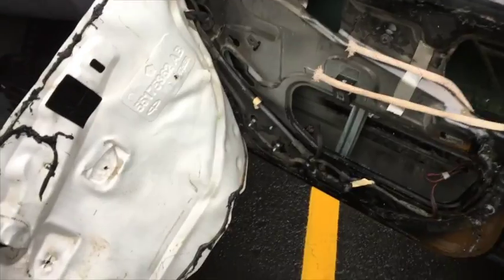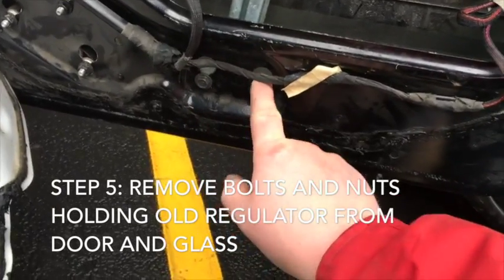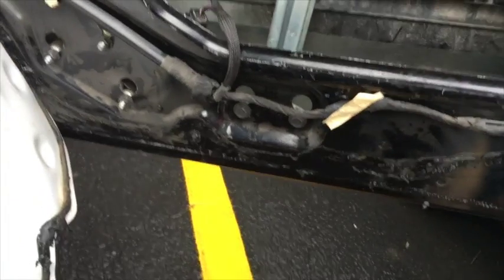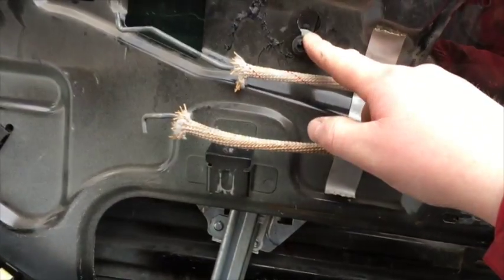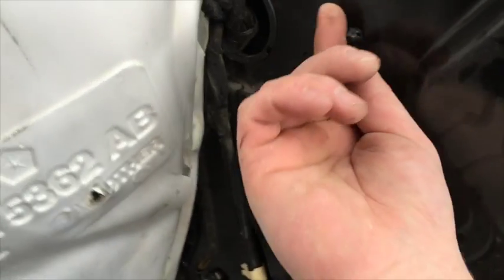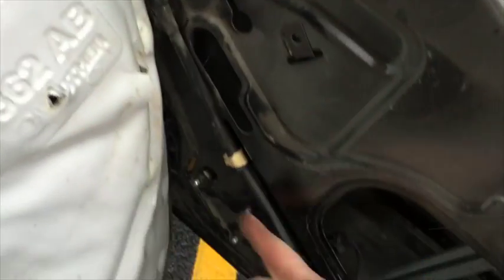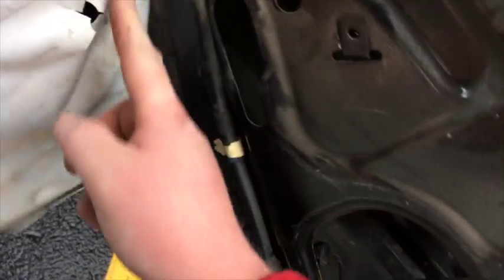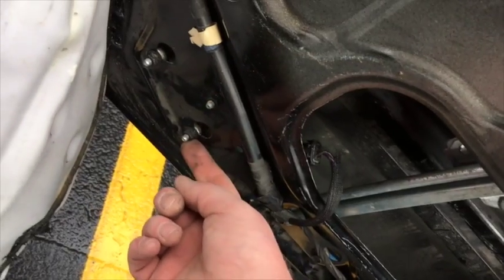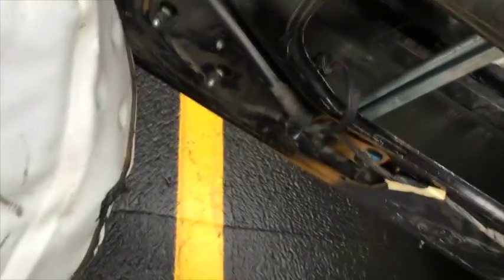And that's about it. So the easiest way to get the door window regulator out is you've got two bolts that come out. You can leave them in and they just slide up and over, but honestly, if you're pulling the regulator out, they kind of just hiccup and get in the way. So pull those out. We've got one up here. You've got to get this plastic piece out because it's actually holding the tube with the track by a zip tie. So work on that, get that out, and then there are 3 bolts holding the motor on. You can keep those on just because the holes are a lot bigger and it just slides up and out. That one's no big deal.